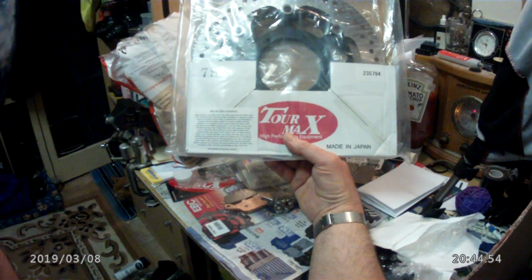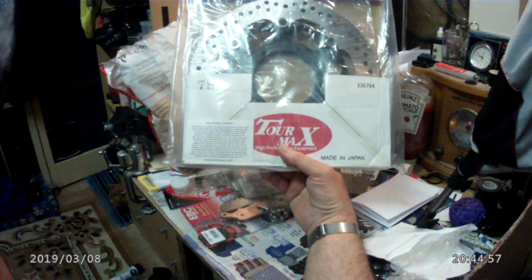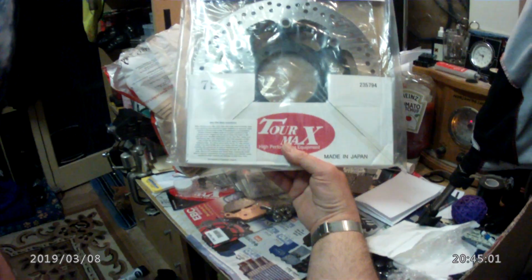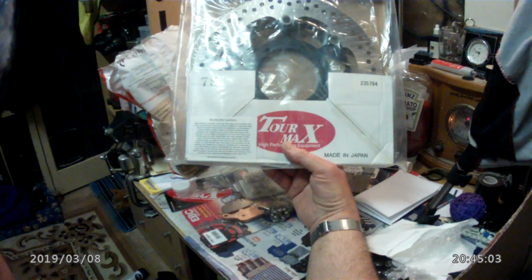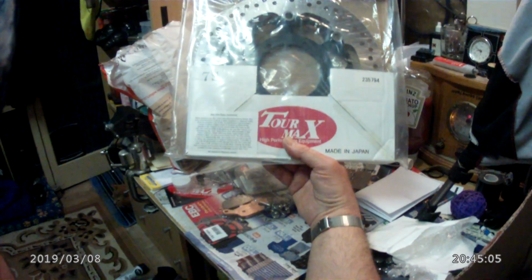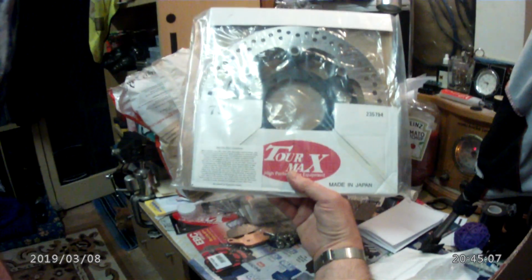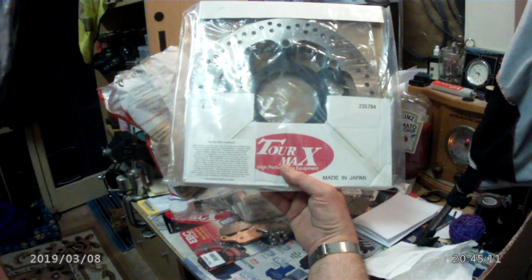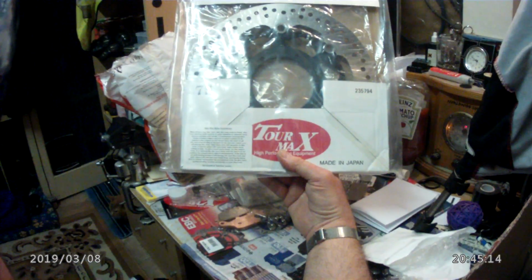That's a bit pigeon English. Rotate the wheel with your hand, apply brakes hard, release brakes, the wheel must rotate freely. Try this several times. If at any time the disc rotor binds with the pad in an off position, the calipers are in need of refurbishment. If the bike is run with binding brakes, it will damage the new disc rotor and pads.